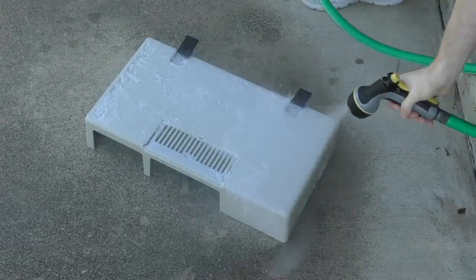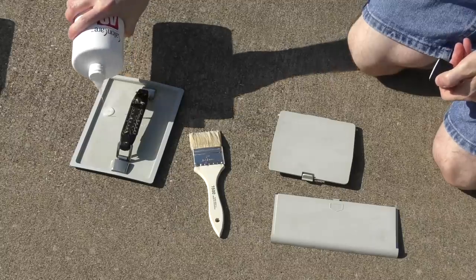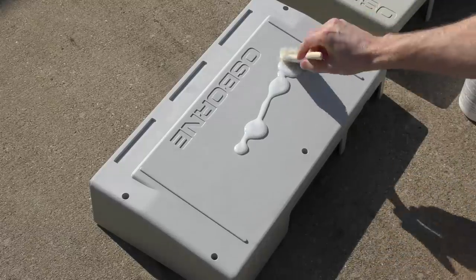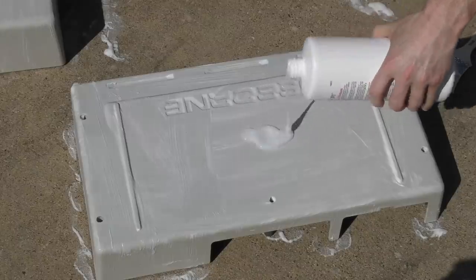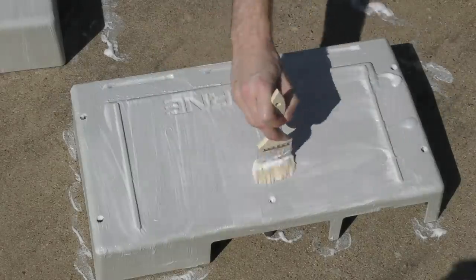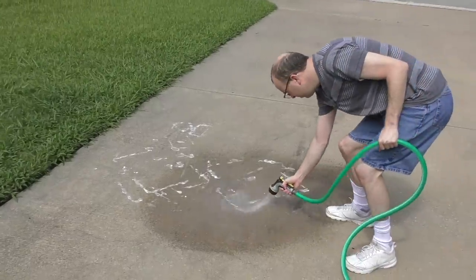The case had been out in the sun for about 4 hours and I thought it was time to rinse it off and have a look. Even though these pieces are like 90% complete, you can see they are suffering from the streaking effect. Several people had been suggesting that I stop using the plastic wrap and just apply the cream directly to the surface. The entire purpose of the plastic wrap is to keep the peroxide from evaporating, so with this method I would have to come out every 5-10 minutes and apply fresh cream and spread it around with a paintbrush — essentially a trade-off between time spent and the end result. After 30 minutes the stuff was becoming very thick even though I had already added fresh cream several times. And here's the result — it looks terrible. In fact, it actually looks worse than it did after my first treatment using the plastic wrap.